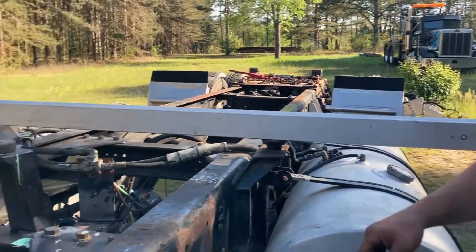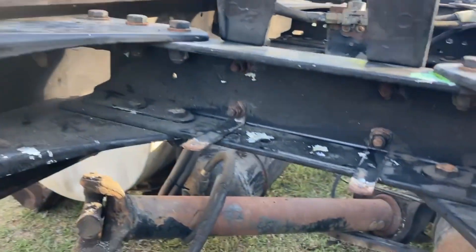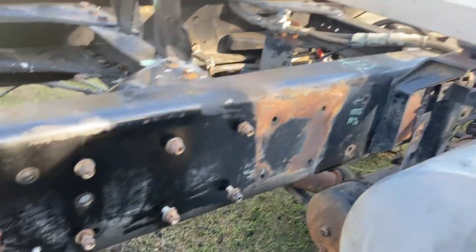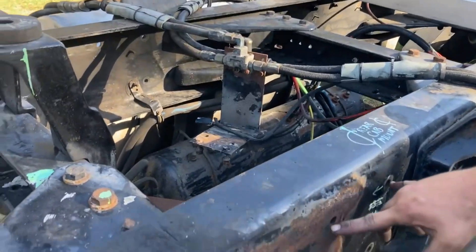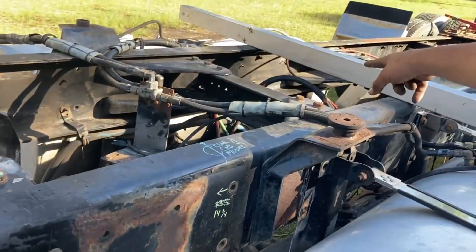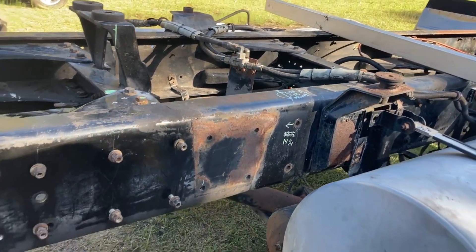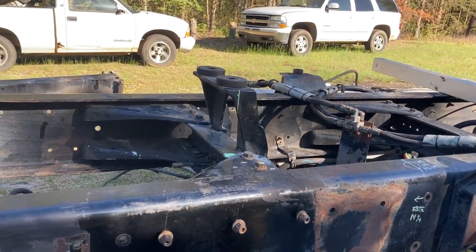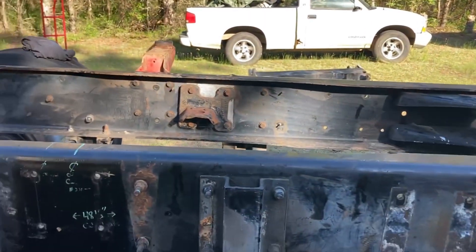It makes a real nice straight edge. That's what I thought. So this one is already in the new holes? Yep, that one's already in the new holes. I haven't tightened it up because there's some exhaust mount brackets that go up here — it's going to go right in here. This cross member used to be all the way back here, right next to that one. So having this spacing on the cross members is not going to hurt anything. That will get the use of the new rear mount and get the cab up higher so that the exhaust can get routed here instead of down under there.